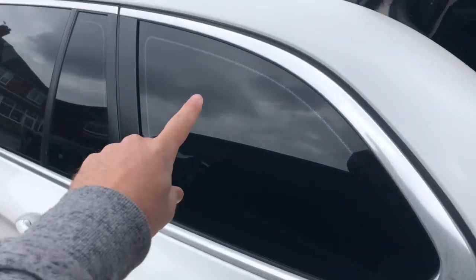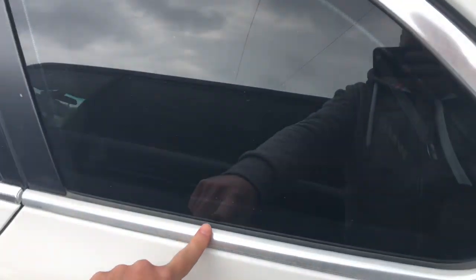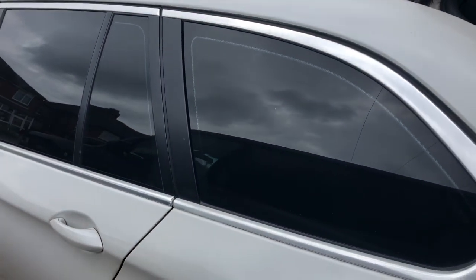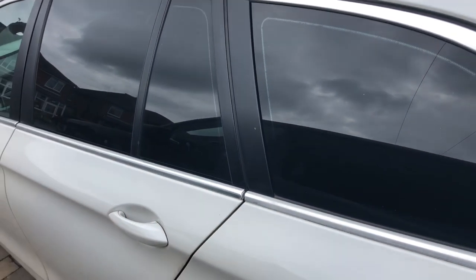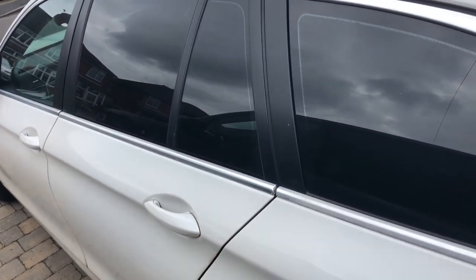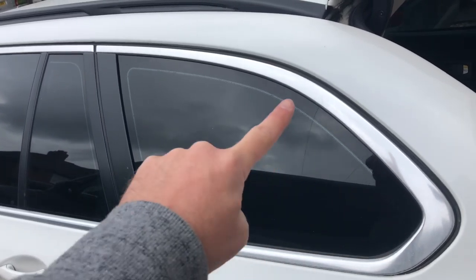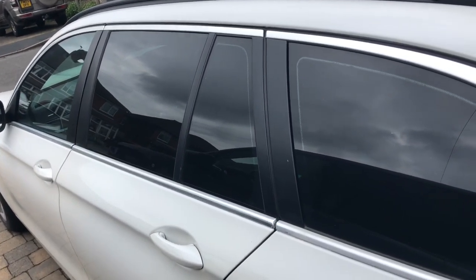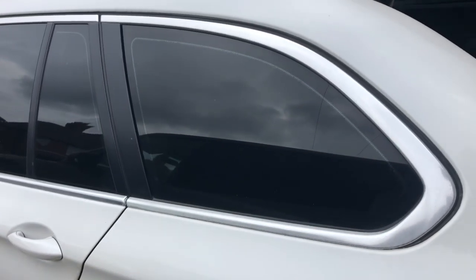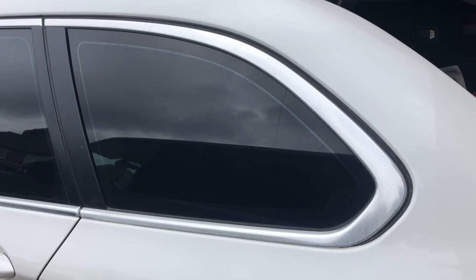Now when it comes to these rear side trims, they all come off but with varying difficulty. The easiest one to get off is this one here — it just comes straight off, literally dead easy. I did manage to get off the silver piece of trim on the rear door as well, though it's not the easiest. The front ones are more tricky. So what I've decided to do is remove these two awkward-shaped ones that come off in about one minute, and then Plasti Dip the other ones on the car — it just saves awkward taping and masking.